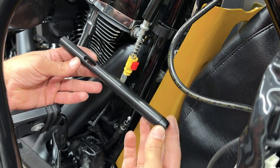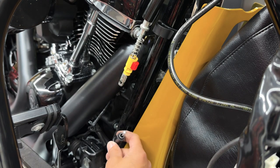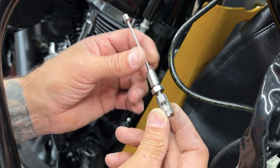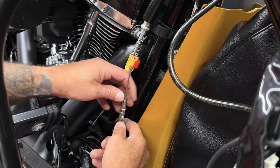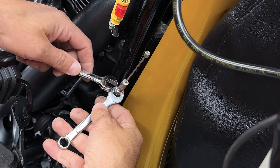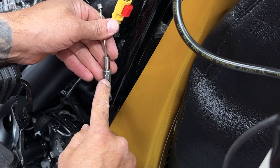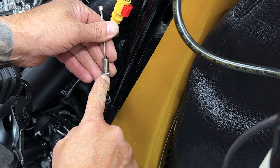So if you're not upgrading to the easy clutch adjuster, here's what to do with just the four inch extension. You just want to remove this yellow tube on the bottom — you have these tabs, just spread it out and it'll pop off. So now you would just take your four inch extension. You have this bottom piece that's going to go on first. It'll sit on the clutch cable just like that. Then you just take your four inch extension, loosen it up. You'll see inside of here that it threads out. Just thread it out far enough where you can slip your ball in. And then once you get it in, just tighten it down. To tighten this up, the bottom is a three eighths and the top is a seven sixteenths. Snug that nut down — you don't want to over tighten.